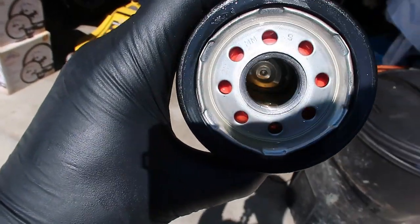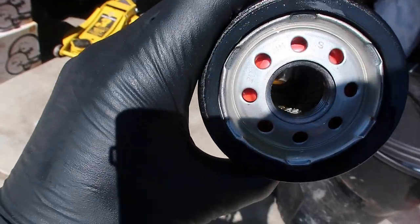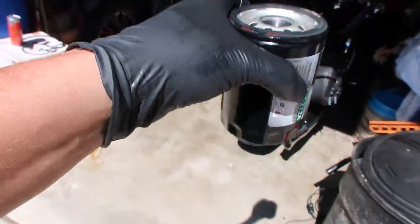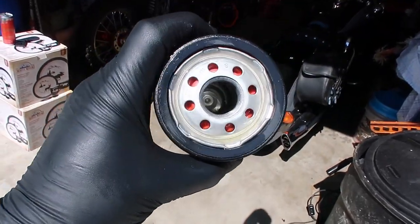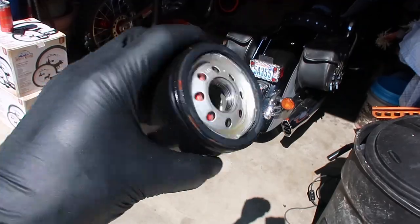You can see there's still a little bit of oil in there, but it's not a whole lot — it's not completely full. That's because when I put it in, I'm going to have to go down, twist it sideways, and then spin it on. This is one of the harder parts to do, and that's why you don't want it completely full because otherwise you're just going to dump it all out.